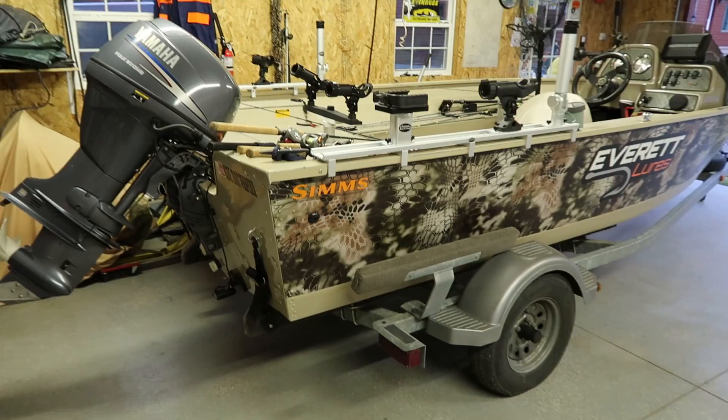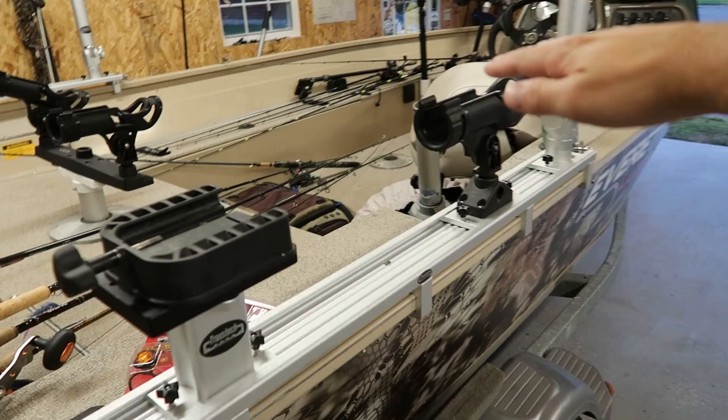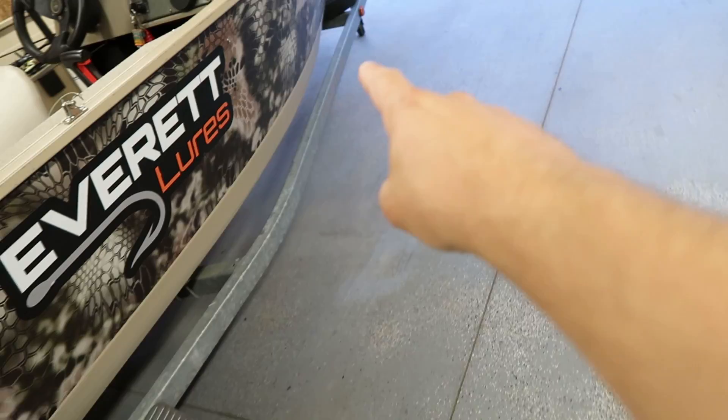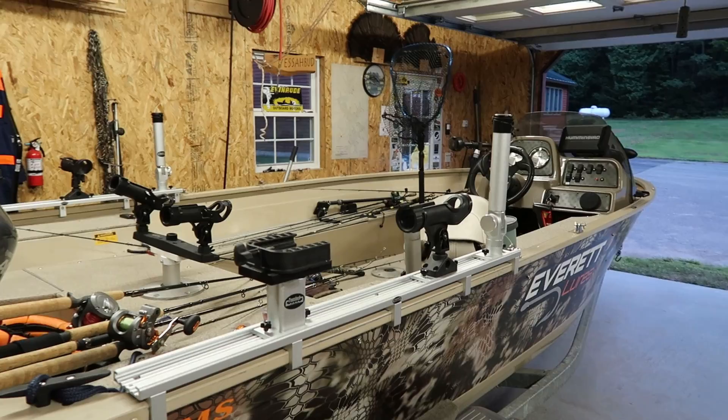It has these little bunks on the side, and I'm gonna build two pieces that come up and stick up just a little bit above the boat — maybe about this high. We're gonna make it out of PVC, and I'm also gonna put a marker light on the top of it. My trailer has marker bulbs all the way around it, and I'm gonna put one up top so when I'm going to launch or retrieve I can see the top of the boat.